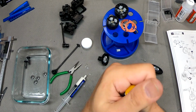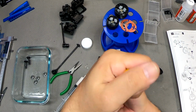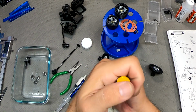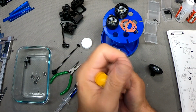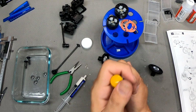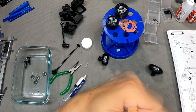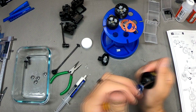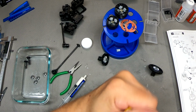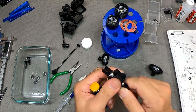Now, when you get one down, don't tighten it down. You kind of want to work these in a little bit of a star pattern. So, when you get one close to bottom, shift over to another one across from it, because you don't want this thing to be askew. And there is our nice smooth differential action. Love it.